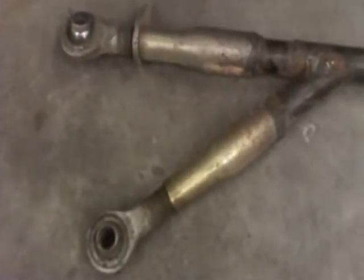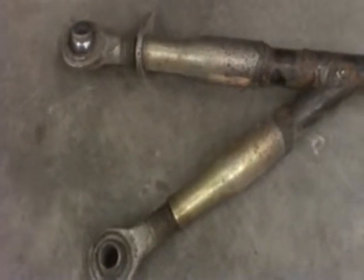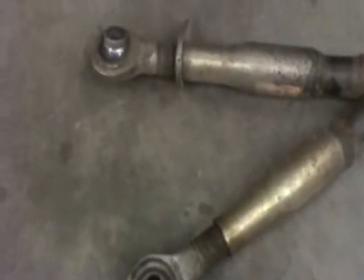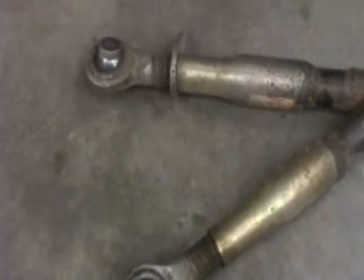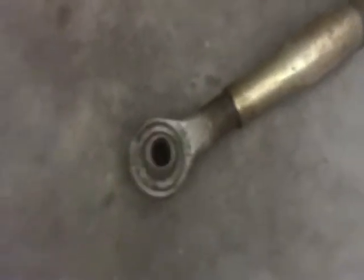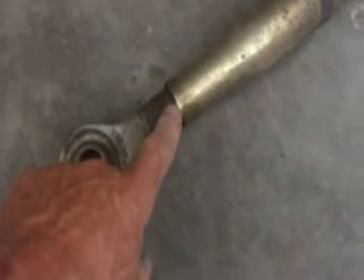I thought I had a good idea, and I bought these links — they're actually the top link on a three-point hitch system for implements behind a tractor. They have this adjustment, which was kind of nice, so you could adjust everything and get the rear end square and lined up at just the right distance back. But one locked down while the others were loose. There was some slack in there when you put the bolt in — a little bit of slack, a little bit in the threads, and then three points — and all that slack adds up. Pretty soon you've got a loud bang and crash when you hit a bump on the road.